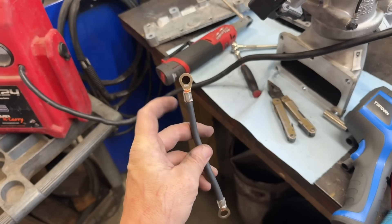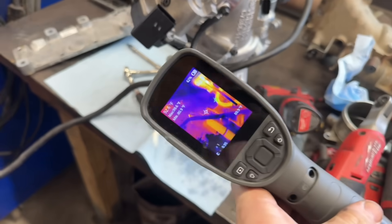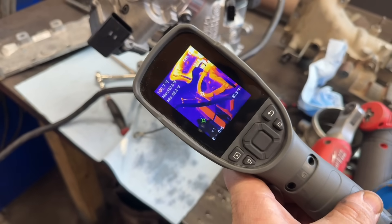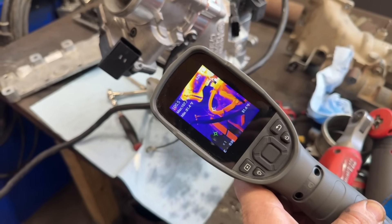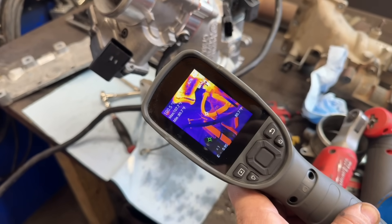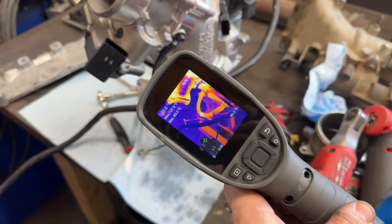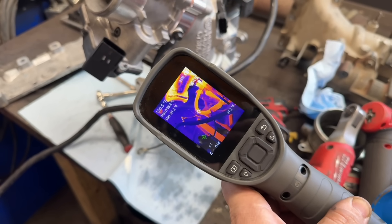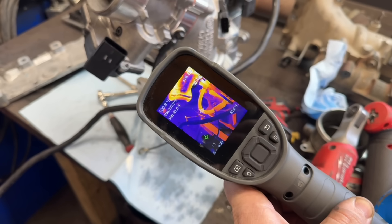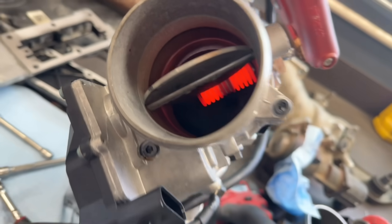It's already been crimped. We're going to solder it and heat shrink it and put that on there. That's a proper ground. If you watch the center of the screen, which is on the wire, it's only 100 degrees — go ahead and hit it. This wire is rated for 50 amps, so we really shouldn't see any increase in heat here on this 6-gauge wire. Still at 100 degrees on the center of that wire, and the heater element is red hot. So now we're good to go.